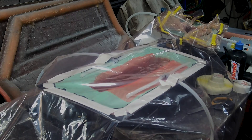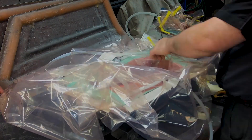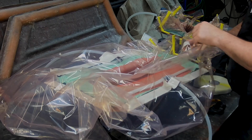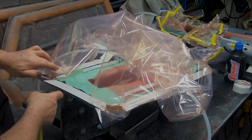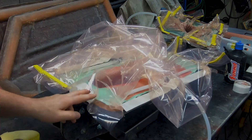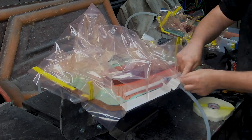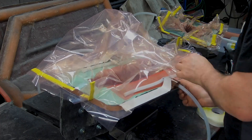I'm going to show you this a couple more times because it's kind of tricky. Here I was working on my intake plenum in carbon fiber — you can see how massive that bag is compared to the size of the mold. I'm going to need some very large pleats in order to get this bag to seal down. I've roughly computed what I'm going to need. Starting at the corners, taping the corners up — I've decided on three big pleats to get the bag into this very deep drawn mold. That last pleat is going in the reverse direction so I can pull all the slack out of the bag and end up with a nicely sealed bag.